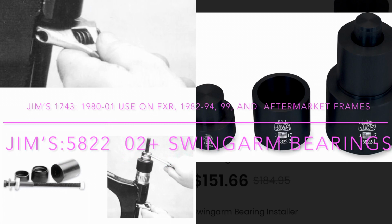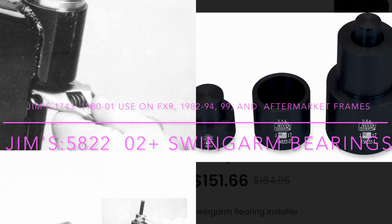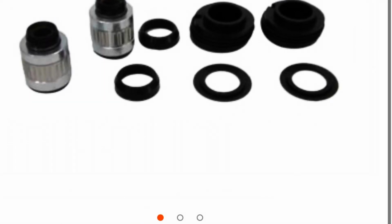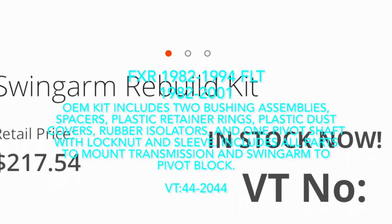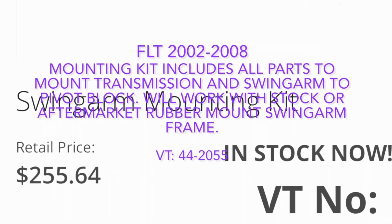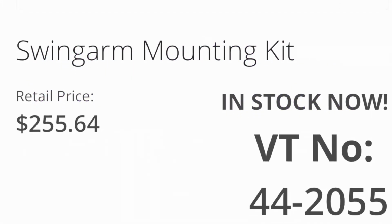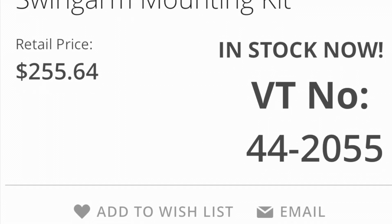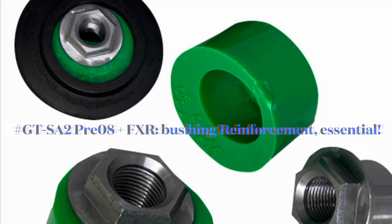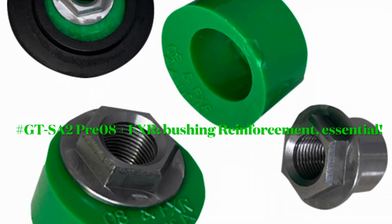From there, disconnect the shocks, top or bottom, and with one hand on the bike, the other on the tire, attempt to move the rear laterally, which is left or right. Any perceived movement is too much and will be exacerbated under load. If you can do it back and forth with your hand, imagine 700 pounds and 80 miles an hour force. Alloy Art makes the best swing arm bushings, being polyurethane instead of rotting rubber.